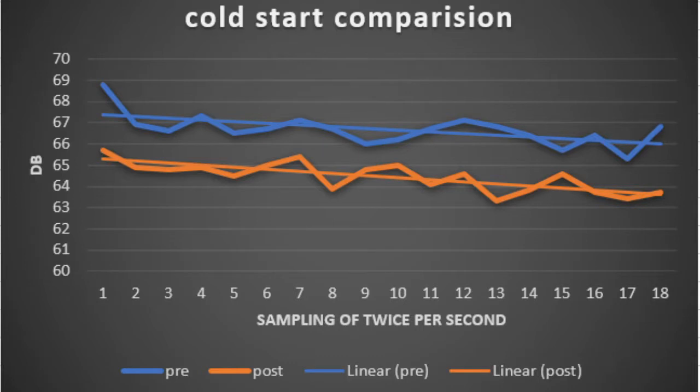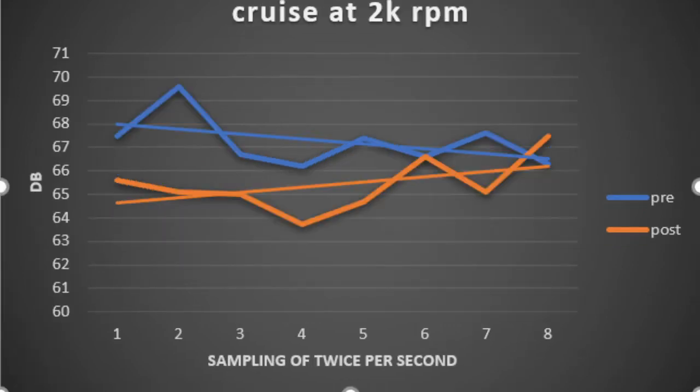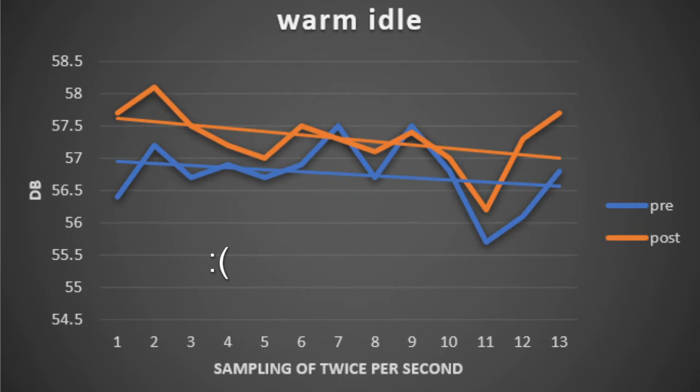To quantify this data, I plotted the comparisons in Excel. The data shows roughly 2 dB difference at a cold start, but the other tests had less of a difference, so it's hard to tell if the change in intensity was due to outside factors. For the acceleration test, the sampling rate didn't allow enough data points to be collected — I should have done a slow ramp up through the RPMs instead. The cold start was also done with a roof above, compared to the second test which was in my driveway, though the stock muffler is really quiet on the outside and there was a big wall beside the car in both scenarios. In hindsight, I should have found an isolated road to do these tests to get more accurate data, and more data points should also have been collected.